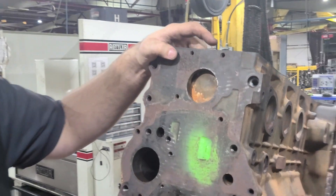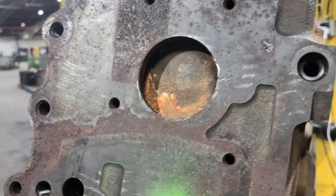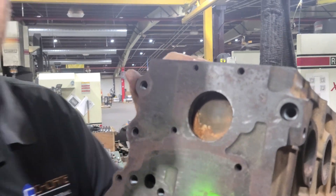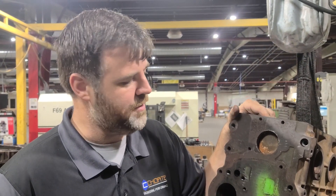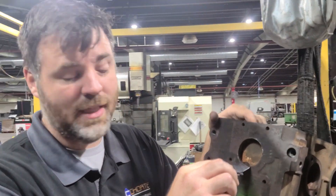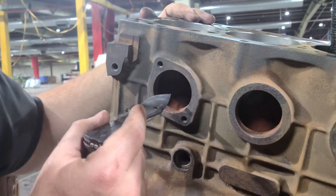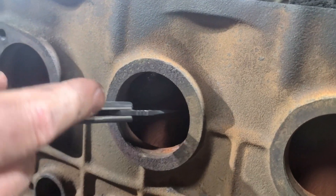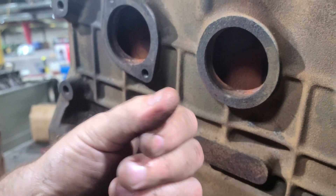There are a couple of things going on. Look at the back cylinder here. Most people would look past that and not think a thing about it. But the problem is — Adam, can I borrow your knife? Everybody knows what a conductor is and what an insulator is. If you've ever done any kind of electrical work — an insulator isolates. What we have here is basically an insulator. This film around these cylinder walls — look how nasty this residue is right here. If I start peeling it off, you can see it on the end of the knife. That's not normal.